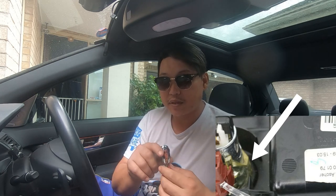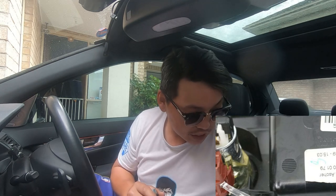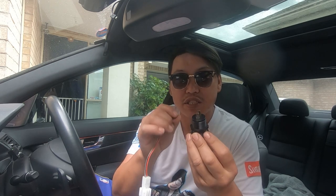Another thing is the ring around the cigarette lighter port insert — it isn't big enough to accommodate the size of the newer dual USB port. In order to overcome this, all I did was grind out the inside a little bit to make it fit. You don't want to grind it out too much — just enough so it slides in perfectly without being too tight.